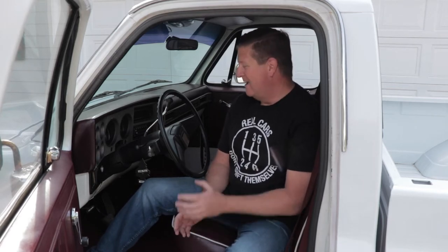Casper, the friendly shop truck that we have here, has developed kind of a strange vibration at highway speed. I don't feel it in the steering wheel — it's not the wheels and tires, I put brand new tires on the truck. I really feel it in the floorboard, and when I go to put the truck in gear, especially if I'm pulling a trailer with my dirt bike on it, I'm getting a definitive clunk.